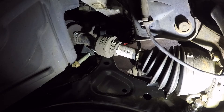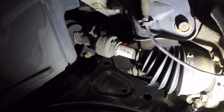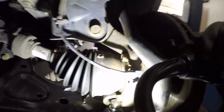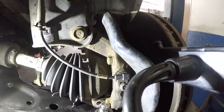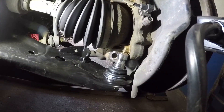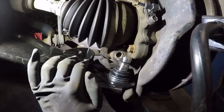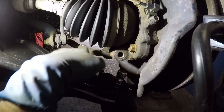I can tap it in all the way. You don't need me to show you how to tighten this — just tighten these two bolts, put the impact gun and a wrench on the other end to hold it. I'm putting the nut on now and this is all done. The only thing I have left is the ball joint into the spindle down here. Be careful with your arms and your fingers — this thing is solid.